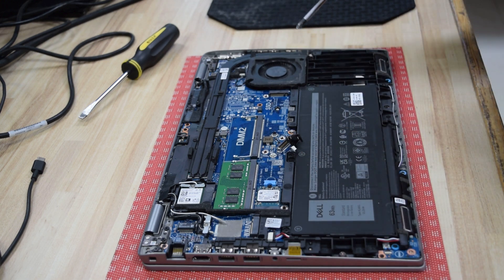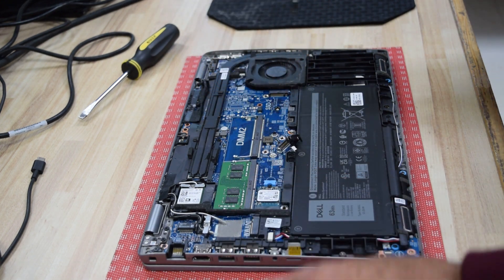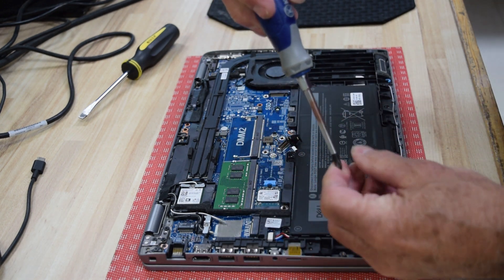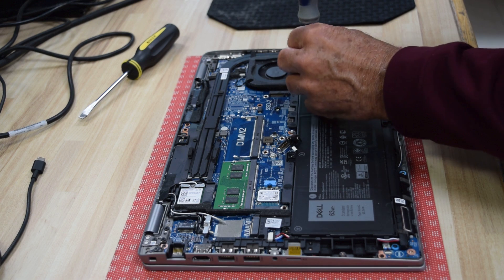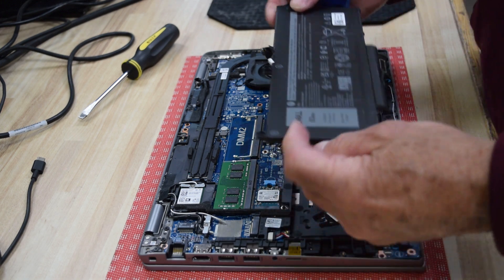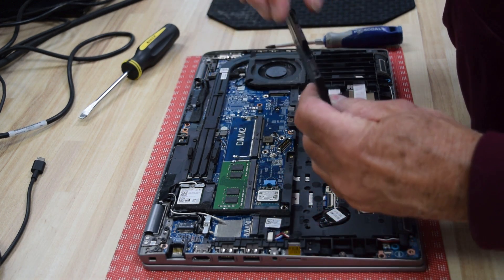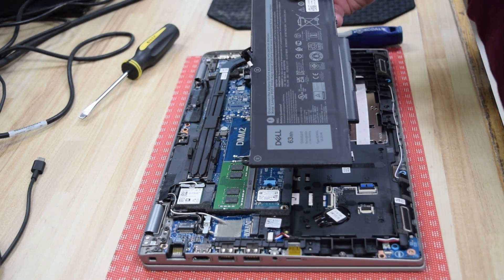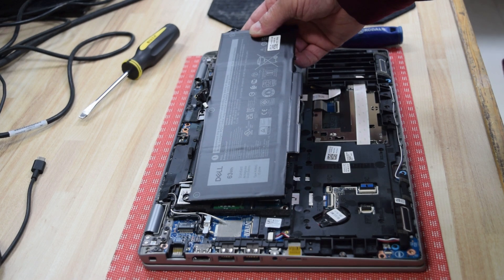Now you've got to take the battery out. There are three screws that hold it. With your same Phillips screwdriver, you take off those three screws. Again, we're going to reuse that cable — if you buy a battery it does not come with a cable. You simply take that cable off the battery you're replacing and thread it down through that channel onto your new one.